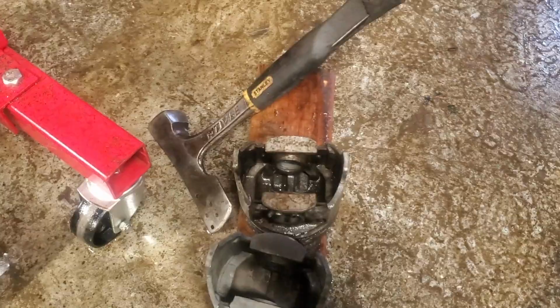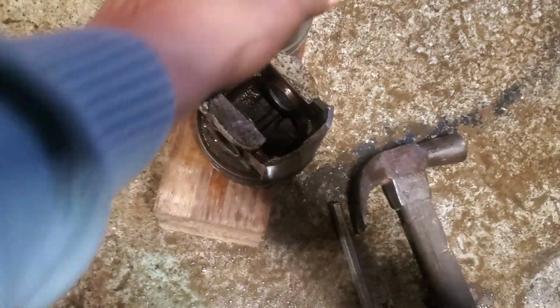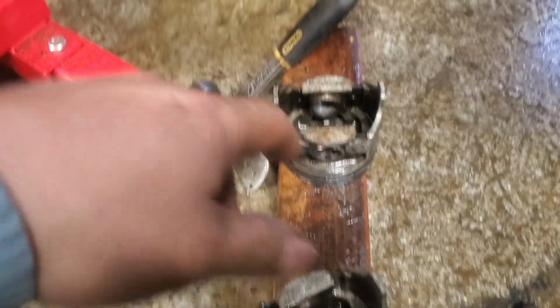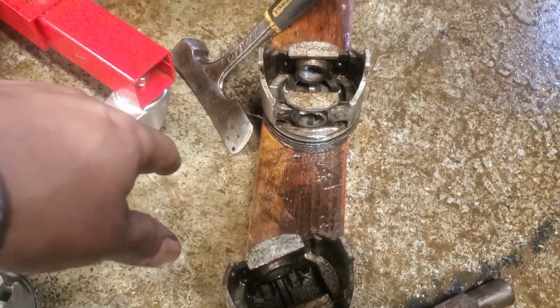All right guys, here is the current situation on the 59's 283. It's been a while since we worked on the engine, so we were trying to get 4, I'm sorry, pistons free, as far as their piston rings that were stuck on there. So now we want to do these 2 and these two, it just wouldn't work. So what we ended up doing was pressing out the piston wrist pin, and then getting some other ones attached to it that we had lying around.